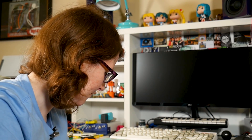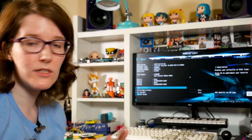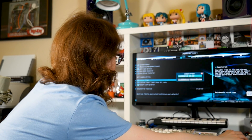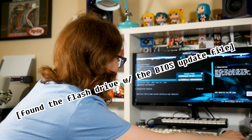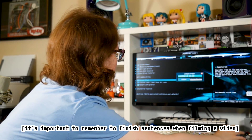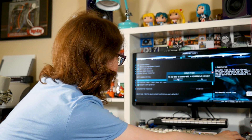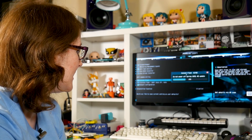All right, so we've plugged in the BIOS drive. Now we're going to power it up with no bootable drive. We hit Delete to go into the UEFI — Instant Flash. It's going to be different on every single motherboard, but it found things. When I click Update, it's going to start the BIOS update. Are you sure you want to update the UEFI? Yeah, let's do it. And now it's going. Now would be a really bad time for a power outage.